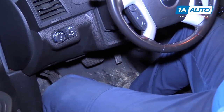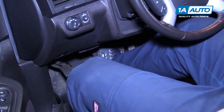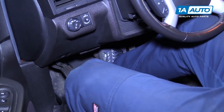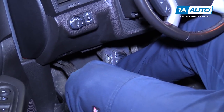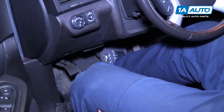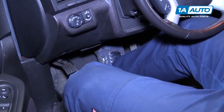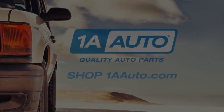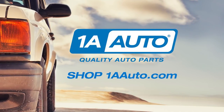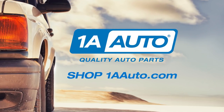Before you start and move the vehicle, gently press on the brake pedal. This will bring the caliper cylinders out that we've compressed to meet the pads. You'll feel it start to build up pressure — you don't need to smash it to the floor, just gently pump it until it builds up pressure. Thanks for watching. Visit us at 1AAuto.com for quality auto parts, fast and free shipping, and the best customer service in the industry.